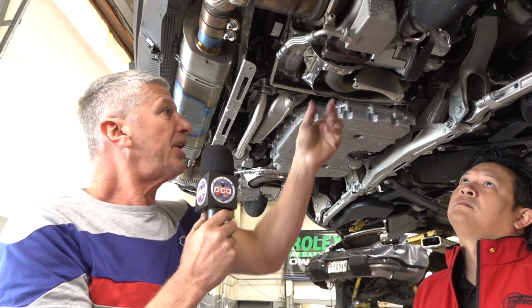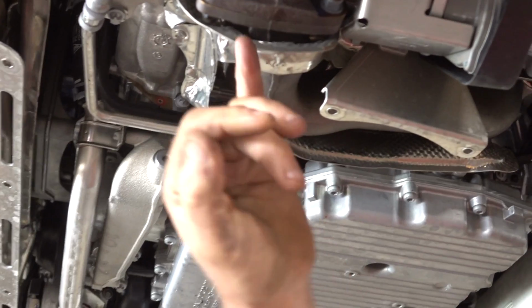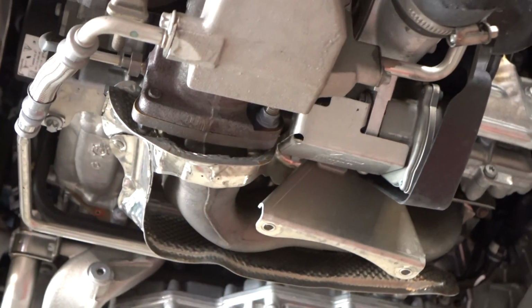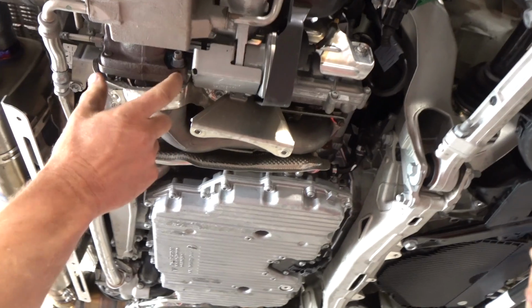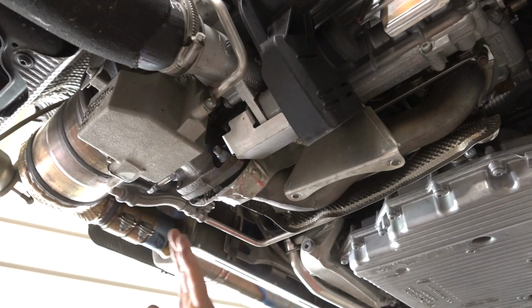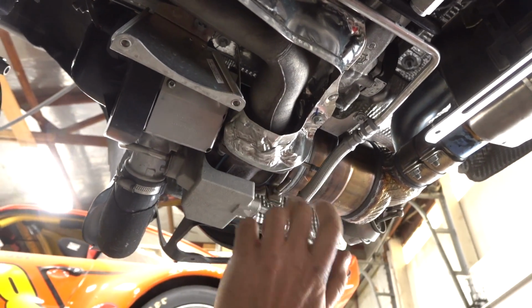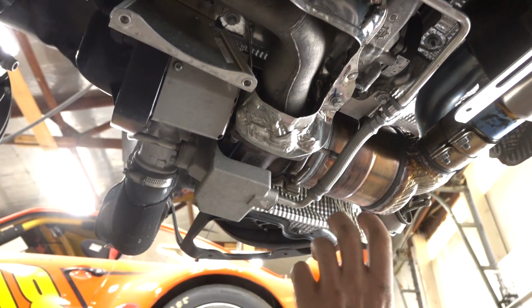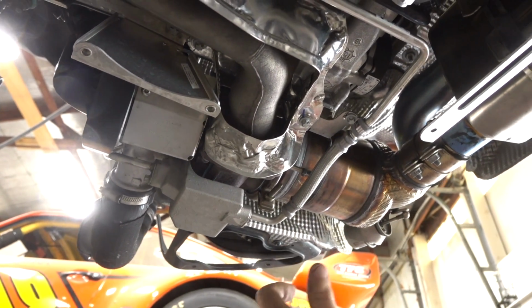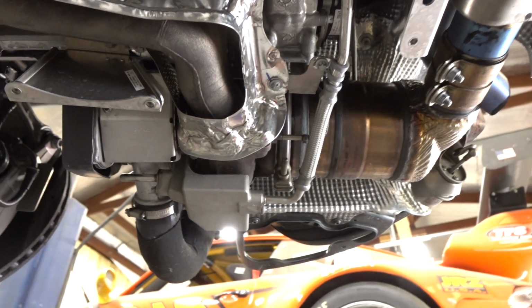And really starting with the exhaust manifold, it is a totally different manifold. The inlet to the turbocharger is much improved. It's a much larger turbine. The turbine cover, and you might get a view also from this side as well. It's still a VGT turbo, so the electric motor right here drives the shutter doors, which controls a variable AR, which is the choke, the nozzle velocity for the turbine section. And this is huge in comparison to a 911 turbo, just like major big.